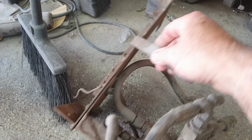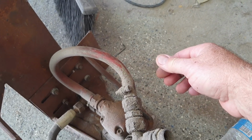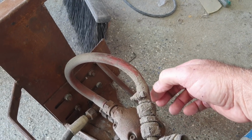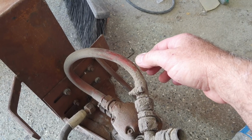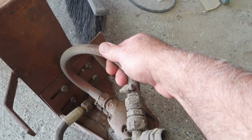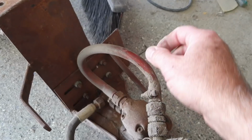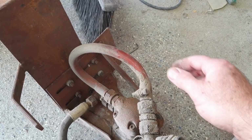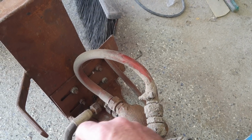Probably be okay, actually, but... Well, this is the return hose, so that's not going to be what they have on that. Or is it the return? It must be, because it has a clamp on it. That's a decrepit, hard old thing. Yeah, it's got clamps on both ends. So I could use power steering return hose. I think I can get that. I'll use that. And then this side probably should be replaced.